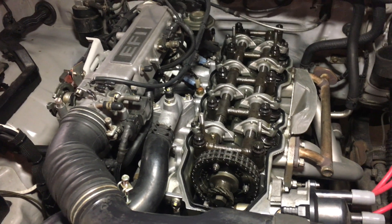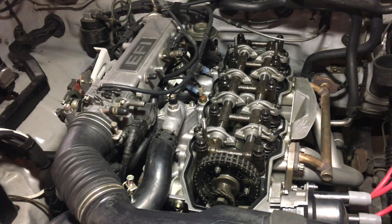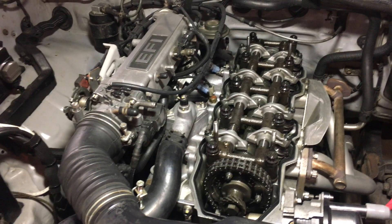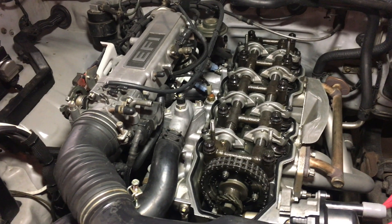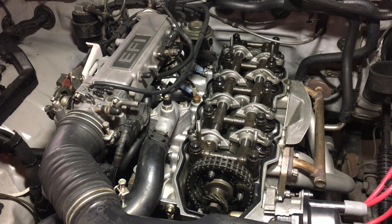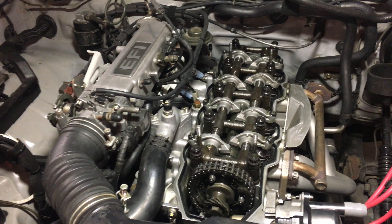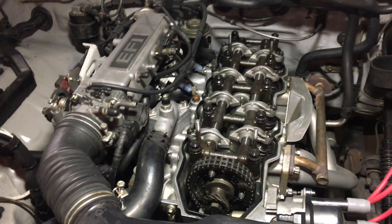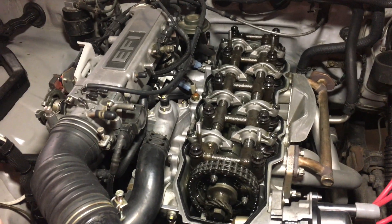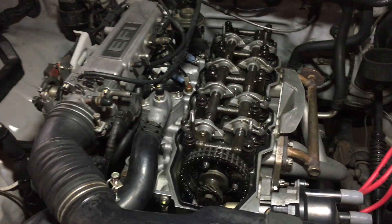My valves are ceramic coated, so that helps a little bit mitigating heat saturation on them. In my experience with the 22RE, if you do run a thousandth tighter — or maybe even end up at operating temperature with two thousandths tighter — generally the motor runs a little smoother and you get as much as you can out of the cam duration. Each thousandth of an inch of lash equates to around 3 degrees of extra duration on your cam card, plus or minus — you've got to calculate the rocker-arm ratios and so on.